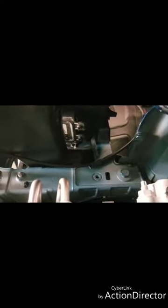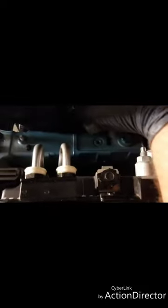Now, in the Steve White kit, you get one, yes, one of these little plastic clips. Now, the ducting itself, as you can see, is gonna go right back there into the intake. But right over here, and I know it's a little dark, let me see if I can get the camera to focus. Right here, there's a spot for a push pin. We're gonna take this, and that's what's gonna keep it from wobbling all over the place. So you just slide it in, and push till you hear it click. Now, this is a lot more stable, which is highly beneficial.